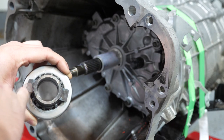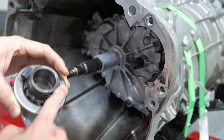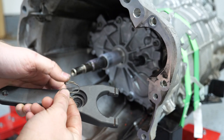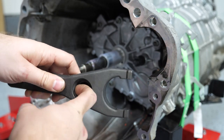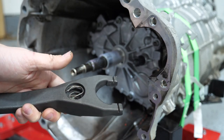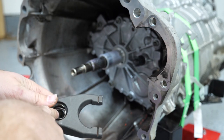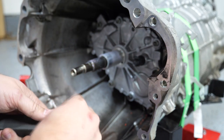I'm also going to apply a little bit of grease to both of the tabs that are sitting on this throwout bearing collar so that when the release fork is sitting against it, it won't have too much friction and won't cause a lot of noise. Now we're going to go ahead and install this tab into the fork. You want to try and get the head of the tab as well as these two fingers on either side underneath the lip that sits inside the fork — doing this can be a bit tricky. What I'm going to try and do is use a set of pliers to pinch the fingers together so they'll slide in a little bit easier, then stick it in head first to get that top tab underneath the inside of the pivot ball location.